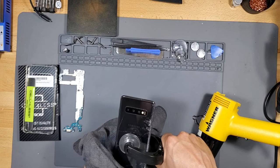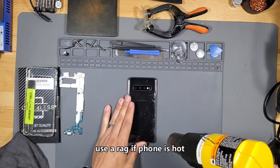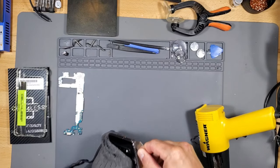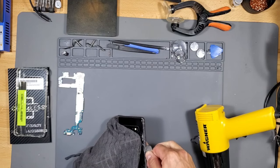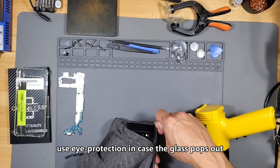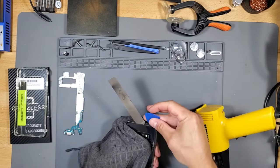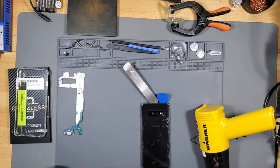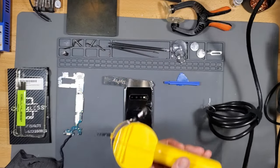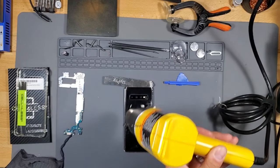It's still not opening, so let's go ahead and heat it up a little bit more. I'm going to start with this metal tool — it's pretty thin. I'm going to start from the corner of the back cover and just slide it down. You don't want to push too far in because there can be cable connections. Now I'm using a guitar pick just to hold the back cover open. I'm going to reheat it, using a metal placeholder so it doesn't melt, to get the other sides.